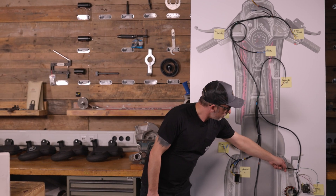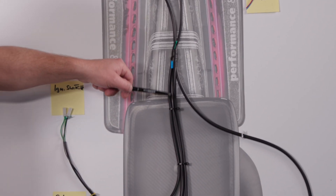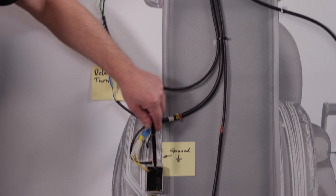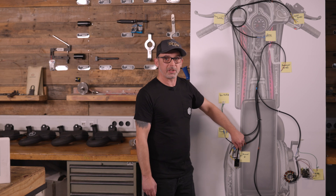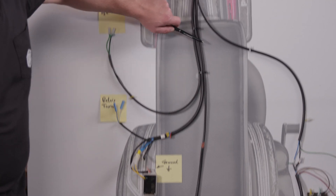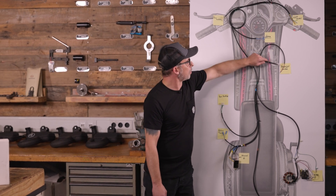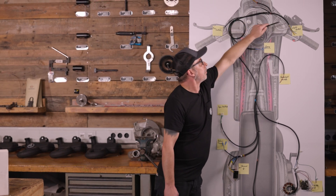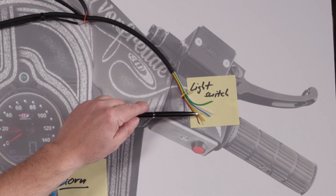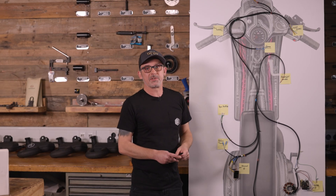The second is the blue cable. This is the current carrying cable that runs in the wiring harness to the regulator. This is where the signal is cut, so that we don't have more than 14 volts in the electrical system. This continues and is distributed here again in the wiring looms: one supplies the brake light switch, one to the horn, and one back here to the input of the light switch. That's all that supplies power to the whole vehicle.